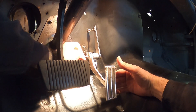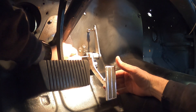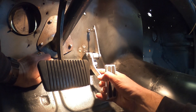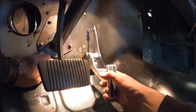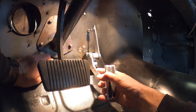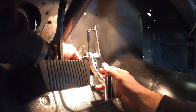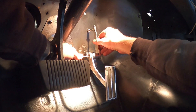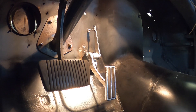There's a fair amount of play in this. I did experiment with putting some extra washers in there but it kind of just made it tight. I need to almost shim it rather than just wash it — I still want it to be able to go tight but take that play out of the pedal assembly itself.